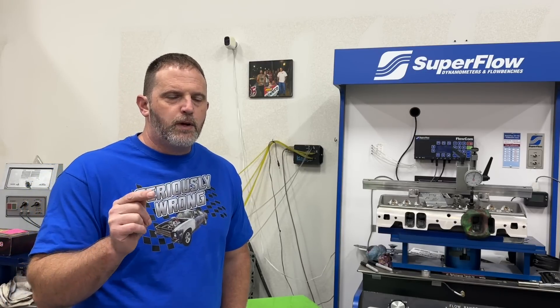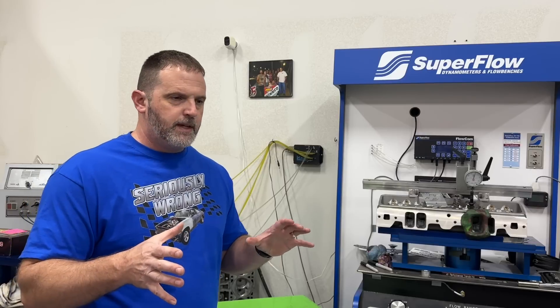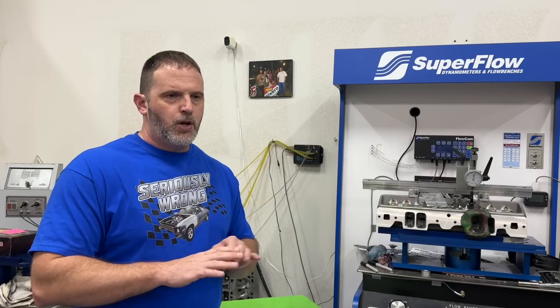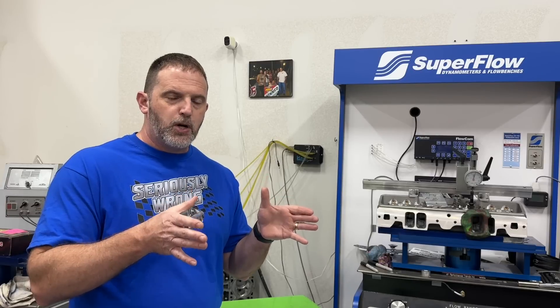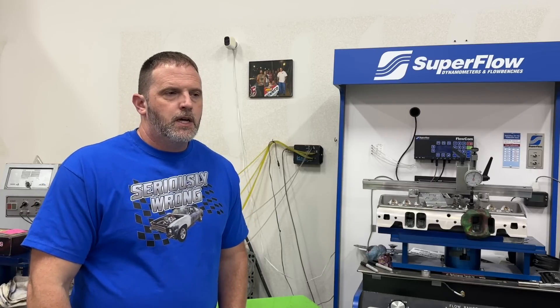In one of the tests in this video, I took off the 1.7 rockers on the intake and put on 1.8 rockers - I'll show you that result. The other thing tested was carburetors. Up top I have an Edelbrock 2896 Super Victor 2, port matched to the heads, with a 2-inch Pro Comp 4-hole tapered spacer. The carburetor tested was a 1050, and also a 1250 Dominator. The engine has 2-1/8 inch headers and is used just for dyno testing.